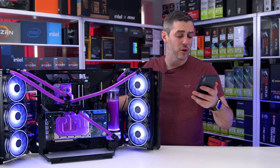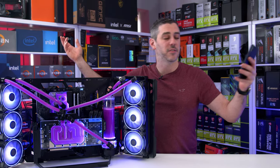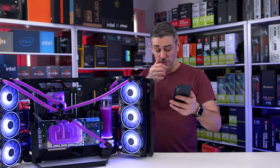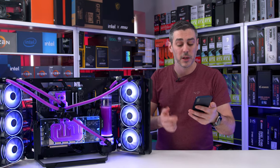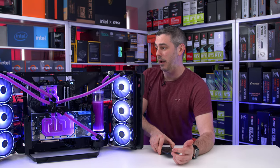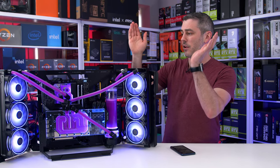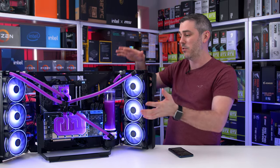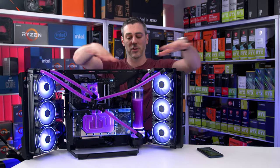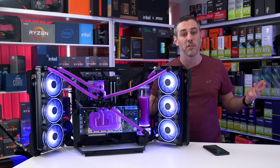Next comment: 'Why the soft tubing? It makes it look amateur on a showcase. This case is awesome but it needs hard tubing.' Test bench — that's all I'm going to say. The sides of this case are hinged too, and I wouldn't want hard tubing to the rads anyway. Could you imagine the weight of this hinged door pulling down over time if it was in test bench mode? This is basically showcase mode. If you had it so the wings are actually up like this and the whole thing's on the desk, it would be in test bench mode — and that's where things would start having issues with hard line tubing.